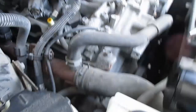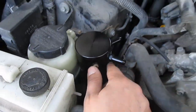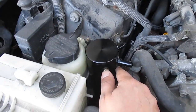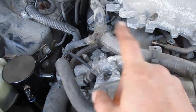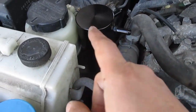What we're going to do is find our position for the can. I've decided to put mine right here beside the power steering reservoir. The reason for this is they want this to be as low as possible so the oil can flow in and drain. As you can see it's already going up a little bit into the intake, so a slight incline isn't going to kill you. But I'm going to put mine here.